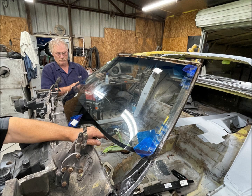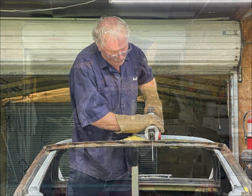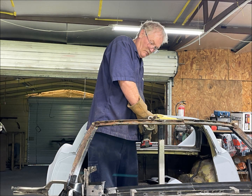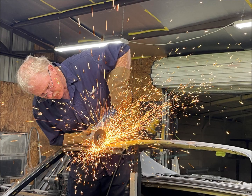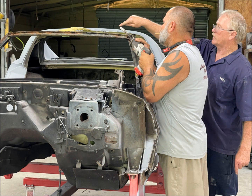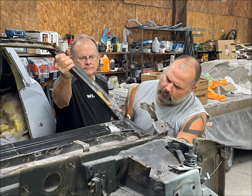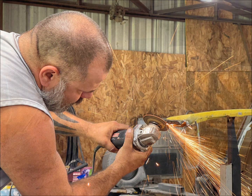A quick test of the replacement window is necessary for assurance of the new parts' placement. What you do not see is the numerous measurements noted for checking placement as the parts were installed. Removing the upper T-top support from the front window frame was very much a chore — be prepared to have the tools and patience for this. It requires finesse and paying attention to not destroy that T-top support front section. Be sure to also insert a well-placed support for that T-top member itself — once the frame gets cut away, you do not want that thing hanging.